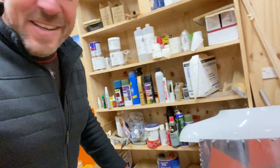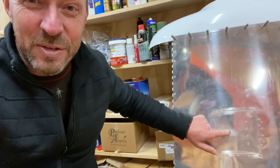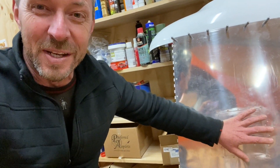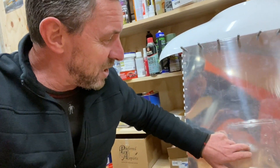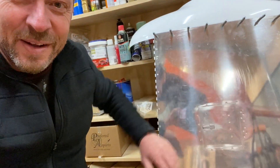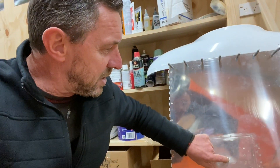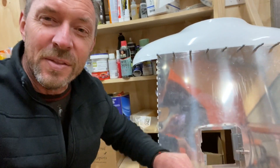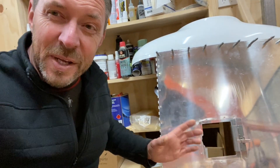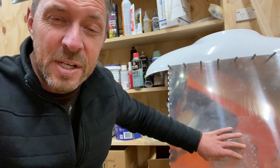This is the upper nose cowl. A couple of weeks ago I made up the oil dipstick access door and I really enjoyed making that. It works very well — I ordered a hidden hinge and a small Cessna-type latch off the internet. It springs up into place and is simple to close one-handed and locks into place. Being a pressurized cowl, I may need to add some strengthening inside — probably fiberglass or a small riveted aluminum brace — if the corners get forced up by internal pressure.